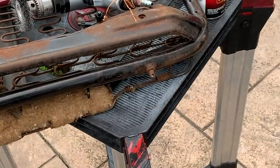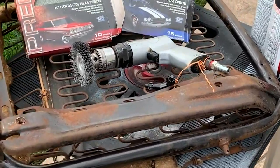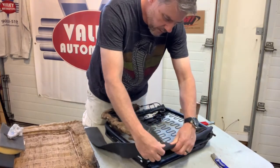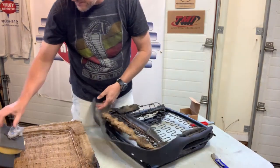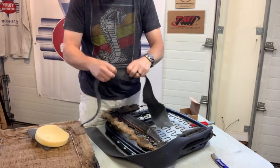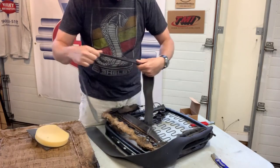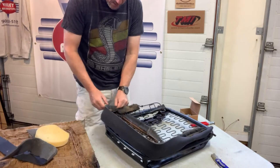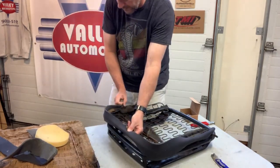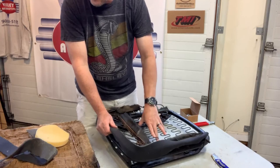It's one of those things where you get it done, and only you know — or photos will prove — that you've done it in such a way that makes you proud. Find something that has a good, soft but durable piece of material. This actually was a piece of headliner we had for an old AMX that we had built out — foam on one side and very tough, like a polyester nylon, very tough to rip or even cut. So it's a great piece of material to wrap around here. Take your hog rings, snap them on, put them in place, hold it tight and uniform all the way around. Once you get that in place, we're going to go ahead and put on the foam seat — that'll be our next segment.